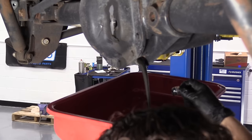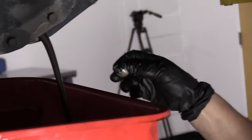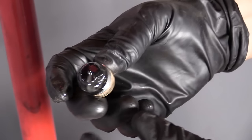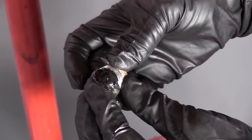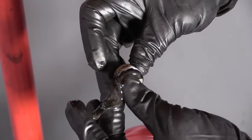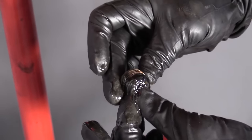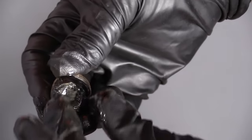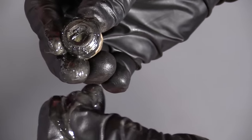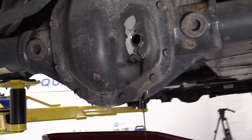Get your catch basin in. So here we have a magnet on all differentials — there'll always be a magnet on the bottom plug or on the fill plug. This is where we would examine to see if we see any chunks. I see there's a lot of metal, but it's not chunky — it's like normal wear and tear, that's the bearings and the gears wearing in. You'll always get that gray powder, but you search for any chunks. I don't feel any chunks, so that's good news. You'll end up cleaning that up before you install it again. Now we're going to let that drain and then take the cover off.